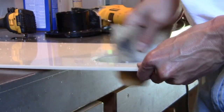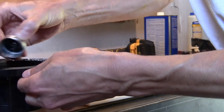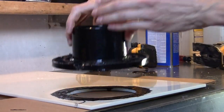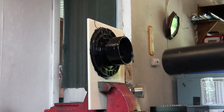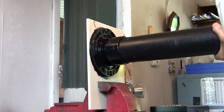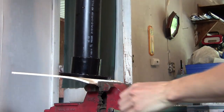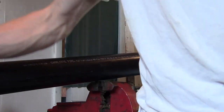60 grit to rough it up. It's tricky to do fast, but you have to because it starts setting. Get it on there — can't see the marks because it's all black. Do a twist. This test piece is a similar scenario to what we're going to do on the black tank. Let's see how strong this is. Wow — there you go! Look what broke first — that's impressive! It passes the test. That is exciting — we can move forward.